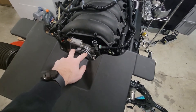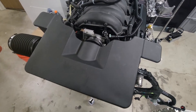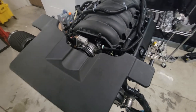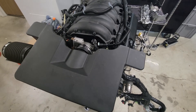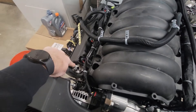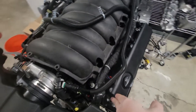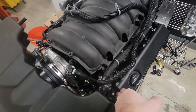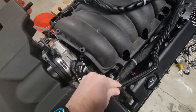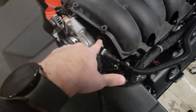The coupling here is larger diameter for the larger throttle body. Another thing to talk about is PCV crankcase ventilation. With the L8T it's a little different — the L8T has a fresh air intake on this side that goes across the engine, comes up here on the driver-side valve cover, and then this hose was connected from the driver-side valve cover over into the intake manifold port.